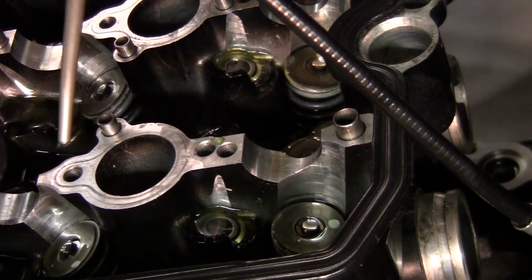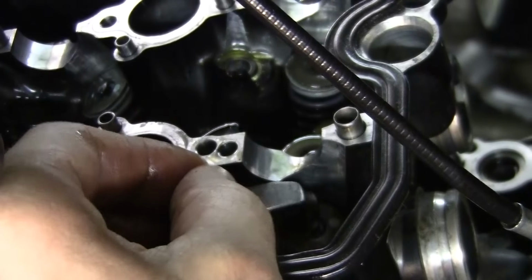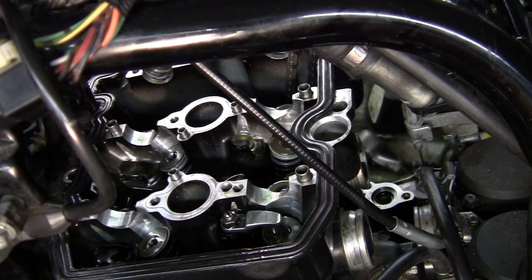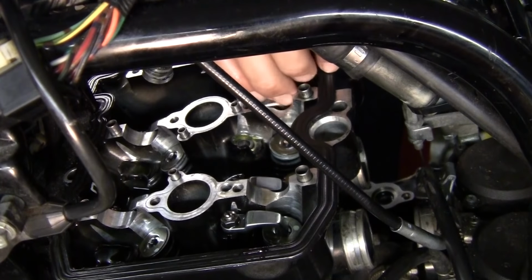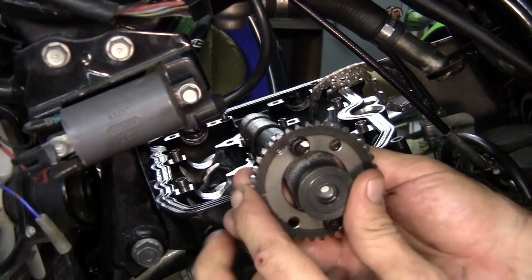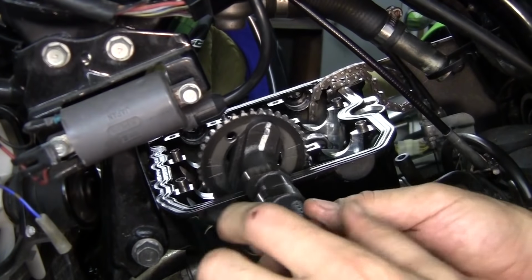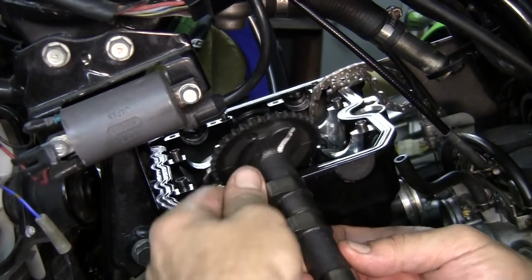Down the springs. You know, this motor wouldn't sit too long, so pretty good anyway. You're not gonna worry about adjustments right now, we're just gonna lay them right in place. That's how they sit. Just lay them all in, all eight. All right, you got top dead center number two. You got the E by the bolt, okay. Your A, your opposing lobe, and your E, okay? So you know this is the right camshaft from what we talked about before.